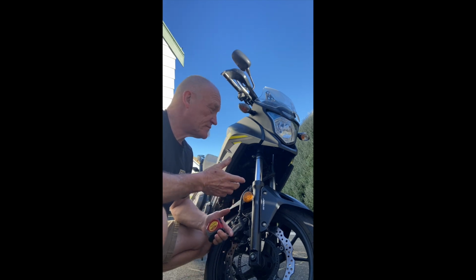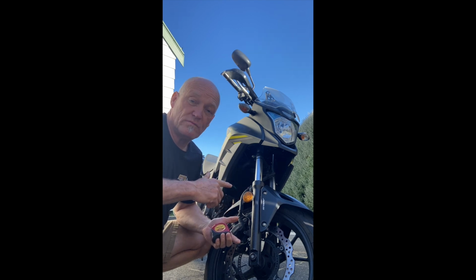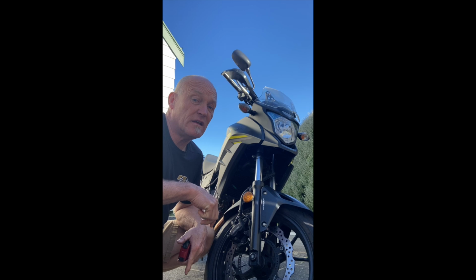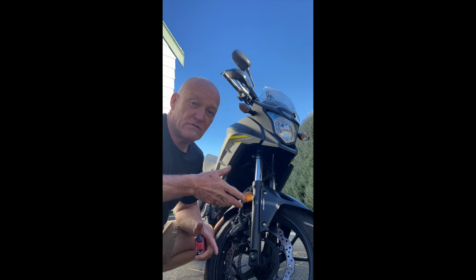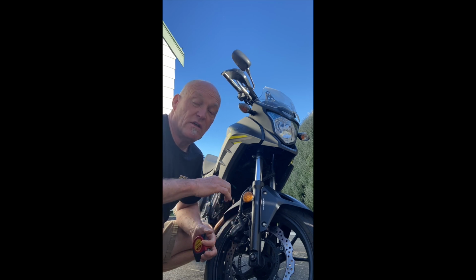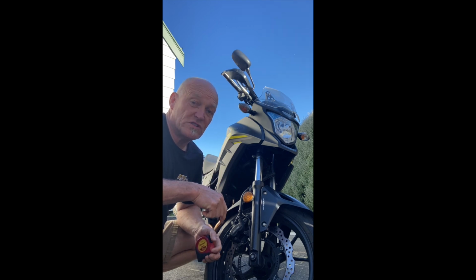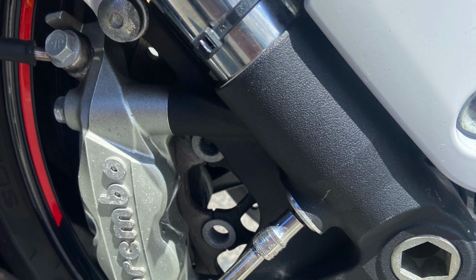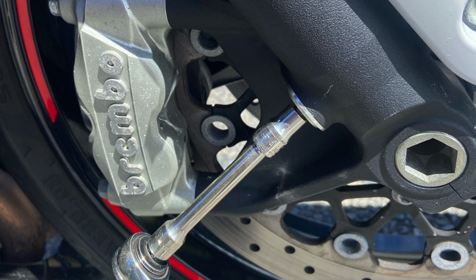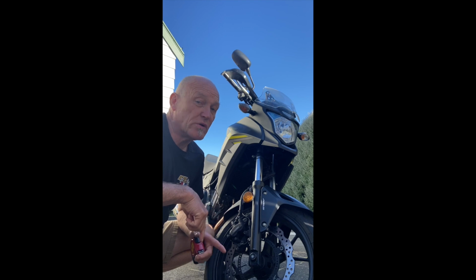So for now, every time I get a bike, I want to know where that bottom out is, mark it, put the cable tie on, and then go see how the rider performs given what we have, and that will then guide, do we need thicker oil, do we need more oil, do we need heavier springs, is the geometry wrong, how can I go ahead and fix it to create braking stability for the individual owner. And on the suspension tuning ride, what we are doing there with emergency stops allows me to dial in preload and compression, if they're available, to be able to support better braking, meaning more braking force over a longer period of time without taking stability away from the chassis.